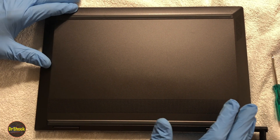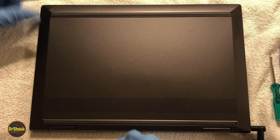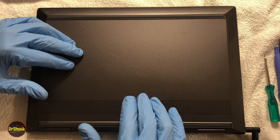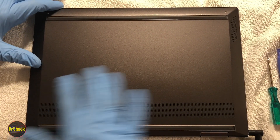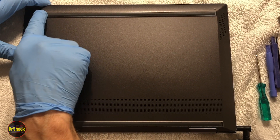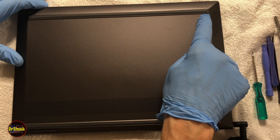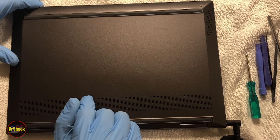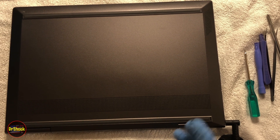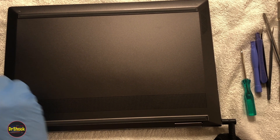That's the end of the repair — battery replacement, bottom cover replacement, and bottom cover feet replacement on an HP Envy x360 13-inch convertible. This happens to be the 13 AG series but that's just a color distinction; this applies to any of these x360 convertibles in the 13-inch size, whether bronze, silver, or black. Last tip: if you're trying to reattach original feet, use automotive-grade trim double-stick adhesive — something very strong from your local auto parts store. If you have questions or comments leave them below, and if you found this useful please leave a thumbs up. Thanks for watching.